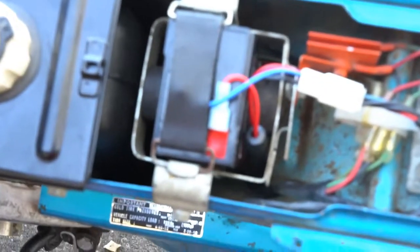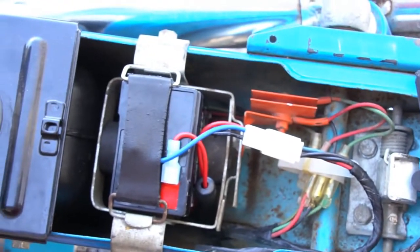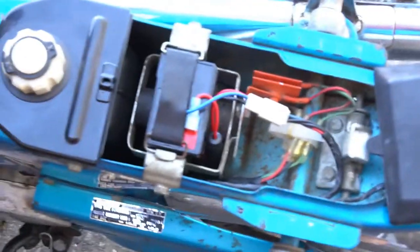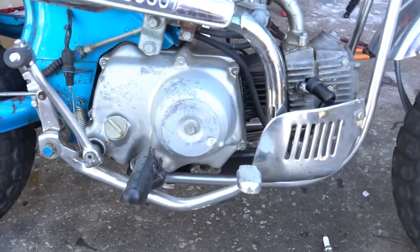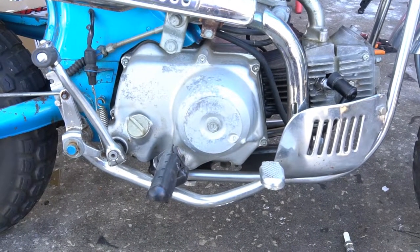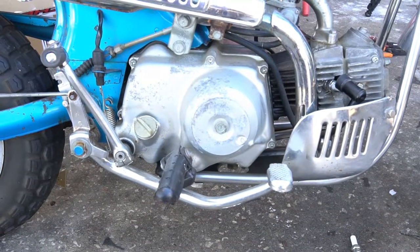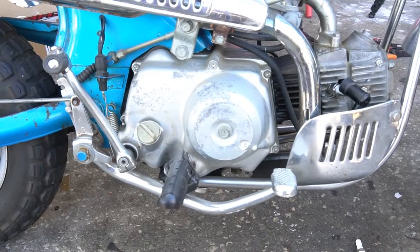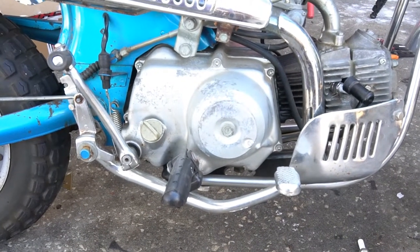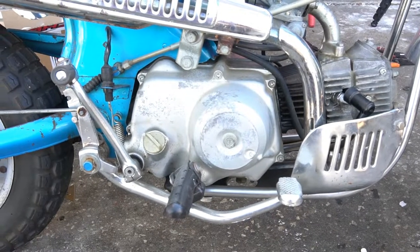I got the old battery out and put a sealed battery in using the old harness — that's verified we have spark. In preparation for the CHP top end kit, you don't need a high-volume oil pump for their kit — that's their claim — so we're not going to change out the oil pump. We're going to do the clutch and put in some new OEM Honda clutches.